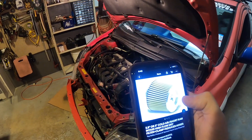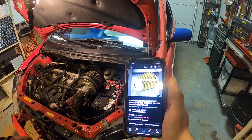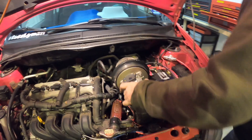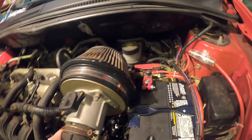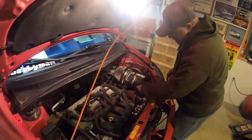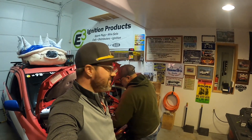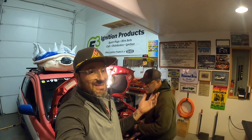That's a two and a half or three inch cold air intake. That one looks a little narrower — that might work. All right, we zip-tied it so it won't bounce around and keeps it away from the terminal. We're going to run a hose from over here into here — same diameter, runs all the way across. It's a PCV valve — when you get blow-by past the piston rings, the crankcase creates pressure, this relieves it and puts it back into the airstream and ingests it into the engine.